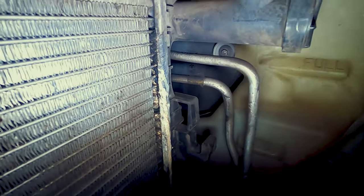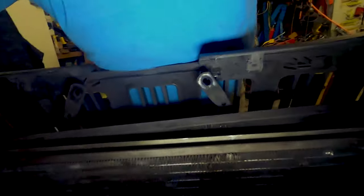Looks like it's been going on for a while. Look at that. Oof. Nice. Okay, now we will drain the radiator using this little opening right here. I will most likely find a little hose to stick on the bottom here. You just turn it. It's a little harder for me. Should be counterclockwise. And then it'll start pouring out of this little nipple here.